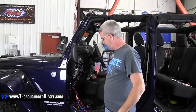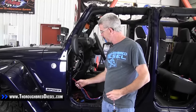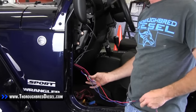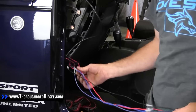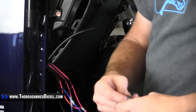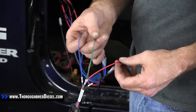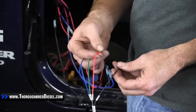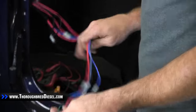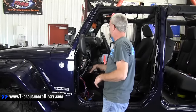I've got all my wiring done. What I did as far as my wiring: I brought all my grounds in that weren't actually out on the battery. I put the grounds that were in on the switches together, put my constant power together — which is a little bit of overkill, I could have slimmed it into one wire. My two signal wires — your blue on the edge and green on the edge — that's the power out to turn your lights on or whatever your device is. Red is your constant power and black is ground. I'll go back in and clean that up, but we're going to finish up our install video by showing you what to do here.